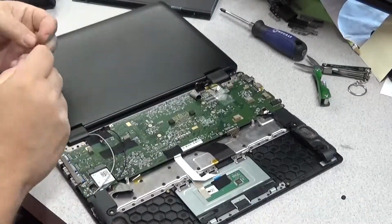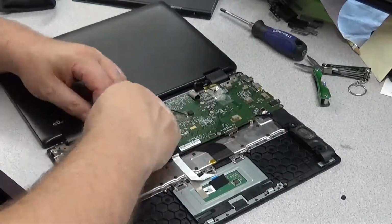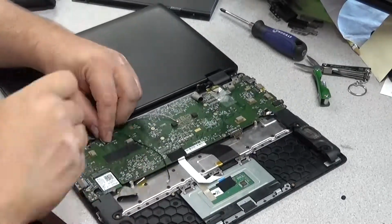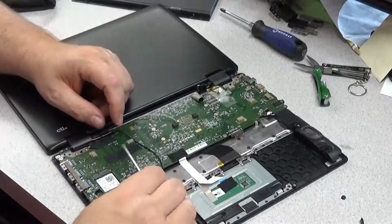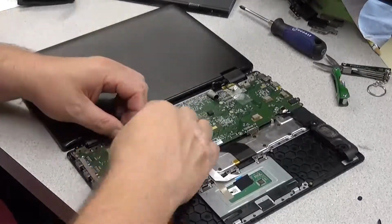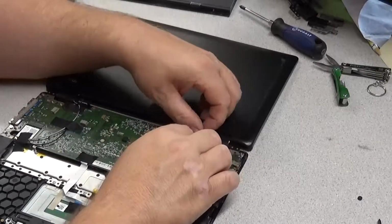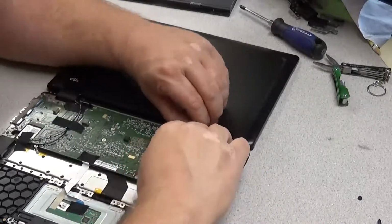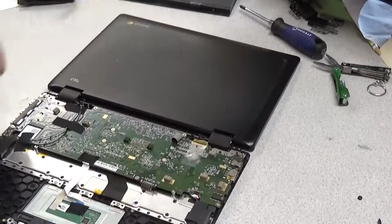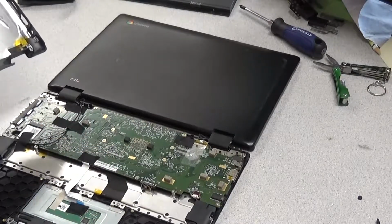But here, on the right side, the video cable, the black one, was actually upside down. You could tell it was upside down because of the way the cable had been folded on itself. Because it was flat, so you've got to flip it over to get it properly the way it should be. So little things like that, when you notice it, you're like, okay. So everything should be connected.